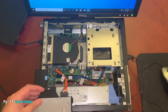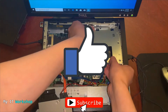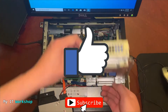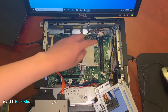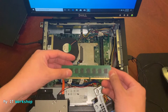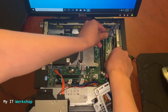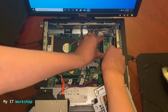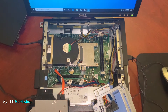We're going to remove the hard drive, and while we're doing that, this is a good time to like this video and subscribe to the channel if you haven't done so yet. As you can see, it's very easy to remove the hard drive. Once that's done, you can see the two RAM slots — only one is being used at the moment — and now we are going to add the second one, the 8-gigabyte RAM module. I'm struggling a bit, as always when doing something technical, and we're going to click it in like that.